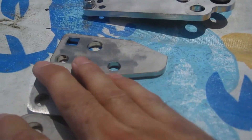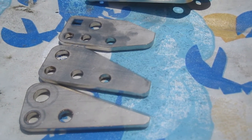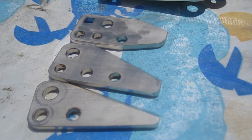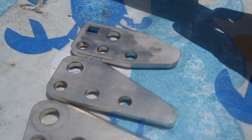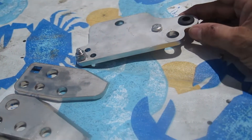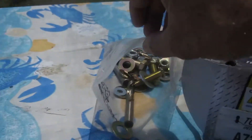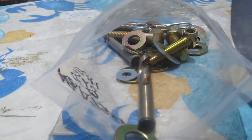You get a series of plates, and you can use one, two, or three depending on the gap size in your spring. Mine used all three because I was able to. You also have this mounting bracket which bolts up to the leaf spring itself. It includes all the hardware you need — the pins, bolts, drill bits, and all that.